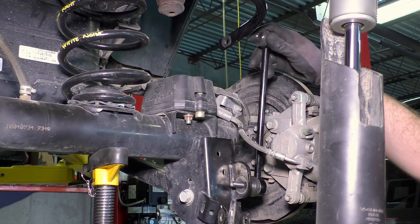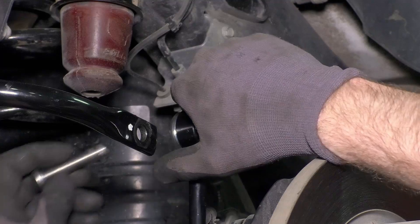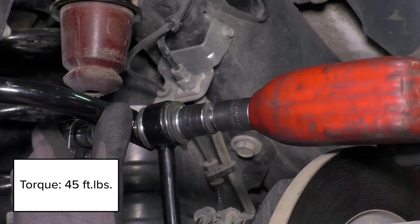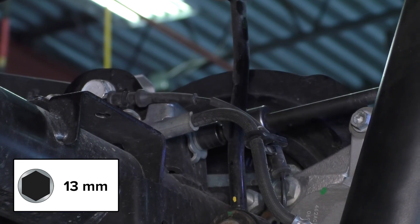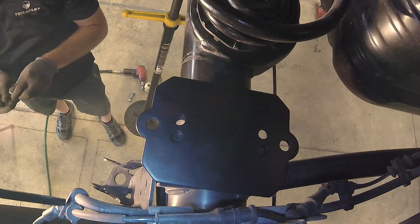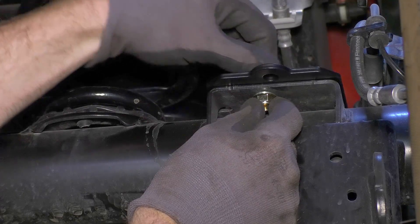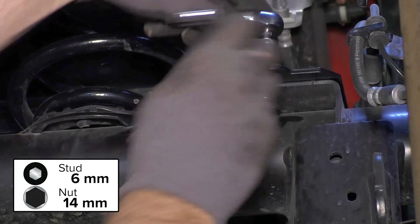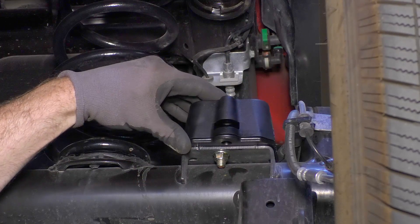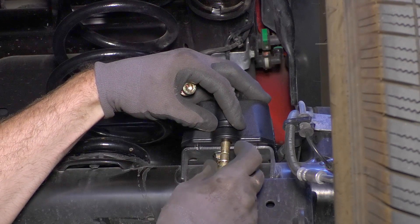To prevent any contact with the frame during articulation, the sway bar link is installed upside down with the swivel stud on the axle end. To connect the sway bar to the link, the provided button head bolts are installed from the inside pointing out. Installing the sway bar link this way ensures the frame cannot make contact with the sway bar link hardware. Reconnect the shocks and brake line brackets. Install the rear bump stop strike pads by placing the mounting plate onto the axle bracket. Two holes on the mounting plate line up with holes on the axle bracket — use these to attach the mounting plate using the provided hardware. Place the rear bump stop strike pad onto the mounting plate and insert the mounting strap into the slot on the bump stop strike pad. Insert the hex cap bolts and lock washer from below and screw them into the mounting strap.